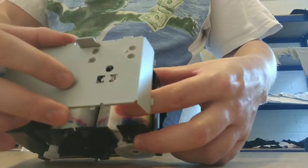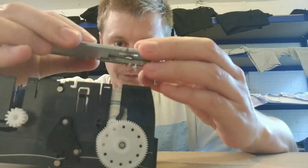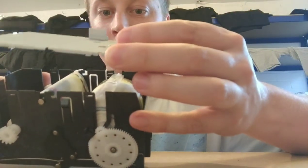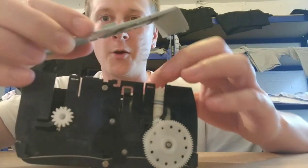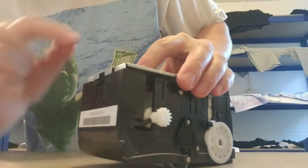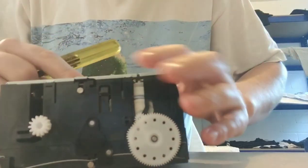So you've got that piece there, the spring then goes back in it. When you put it back together, you've got to line that spring up perfectly for that hole there. So you start with the spring. First of all, you put that plastic bit back and start by lining up the spring, get that in the hole. Then you can start closing the, I'm having a mare. I have done this before. Right, and then that piece, so start with your spring, and then pop that end on first. Keep your pressure down because of that spring, not that it's crazy tension.